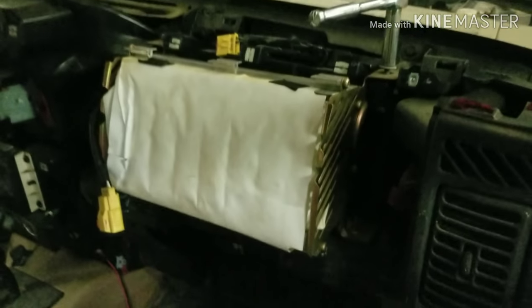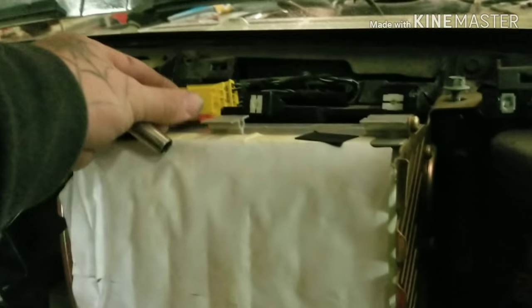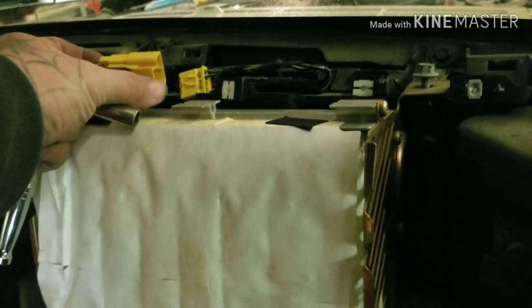When you're removing this airbag, I've got four — let's see, what size is that? I think there's 10 millimeter bolts that hold this together. First you're going to want to unplug your battery or remove your airbag fuse. Unplug your battery and let it sit for about 20 minutes. Then we've got one plug that runs up on the side here, right up on the top. Get that slide, take that loose, unplug it. Then take the bolts off — the sucker's going bye-bye.